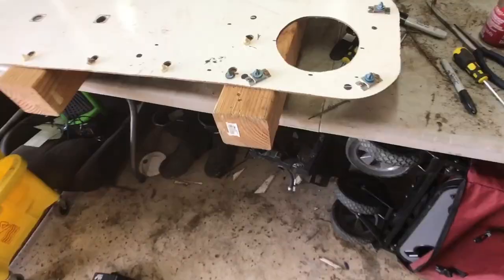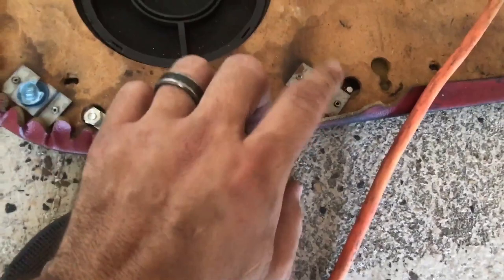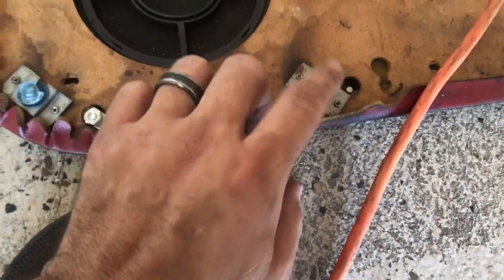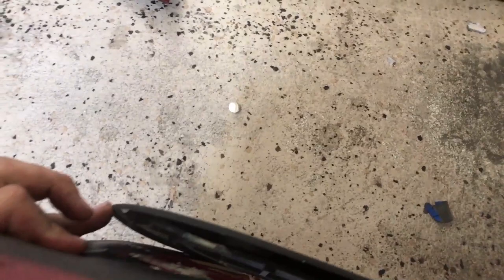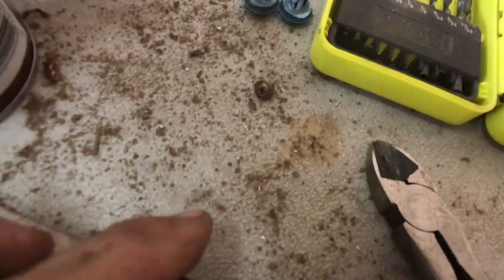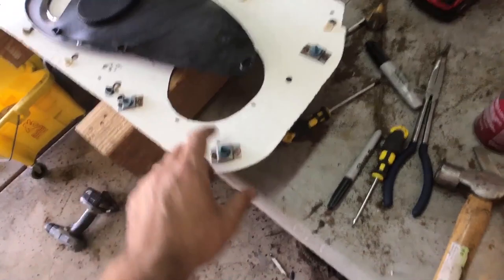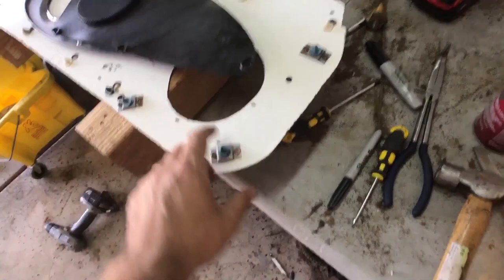I went ahead and put those little brackets on — they're riveted on. If you have a small rivet gun, go ahead and rivet them back on, that's the easiest option. Your second option is to use the small screws included with this plastic piece. You need exactly six for this. I'm going to use a slightly longer screw for the plastic and shorter ones for the bracket. They were sticking up on the opposite side so I took the angle grinder and just shaved those little points down so they don't poke or scratch the panel.